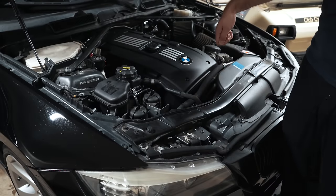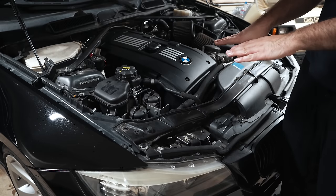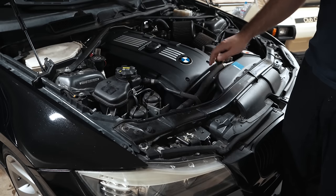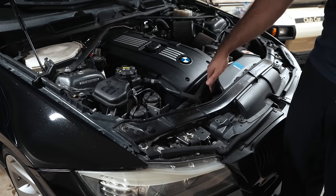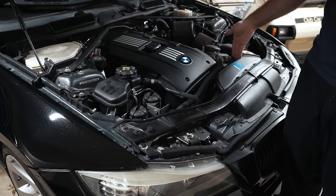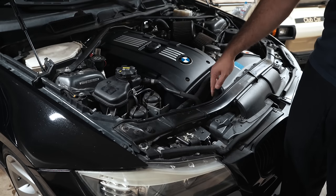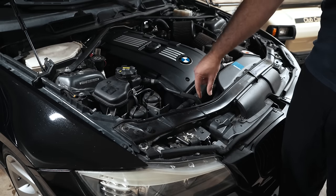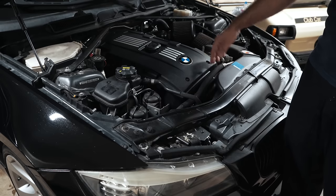I probably made pulling the fan shroud out look a lot harder than it really is — it's because of my aftermarket intercooler and the fact that it's kind of pushed up and out. So trying to pull it up, I was fighting the resistance of the intercooler. Same with putting it back into place — it's normally not this difficult. That's probably the most time-consuming part for you guys: getting this out and also putting in the radiator. Make sure you put the driver's side in first, slide it down the plastic channel, and then focus on the other side. The transmission cooler line just clicks in — you only have to unscrew that side, then you can unclip that from the transmission cooler and get it out a lot quicker.